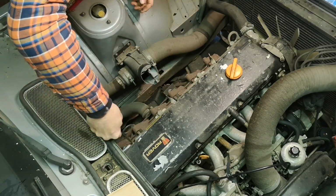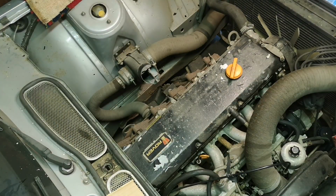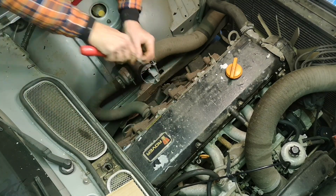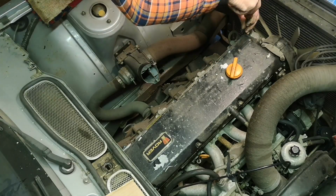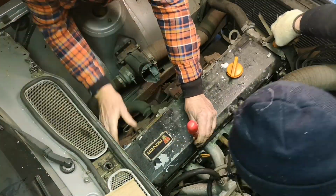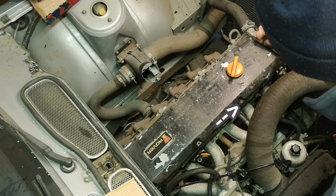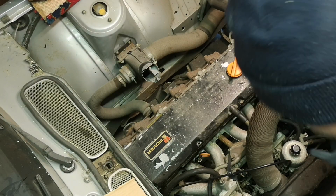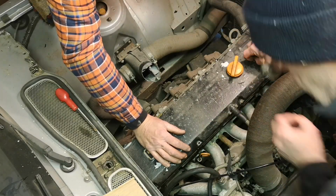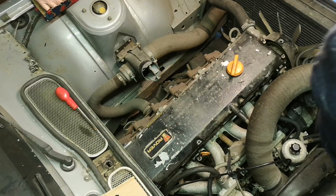The screws on either side holding the cover down are M5 Phillips, and although it showed there's some Loctite on them, they weren't held down with any amount of torque. They just came off really easily. However, one of them, which I'll point to in a moment, was like that one. It was like a flat crosshead roofing bolt, which seems rather bizarre. It's been replaced. Okay, that's the bracket holding the cam belt cover.